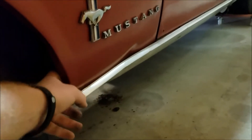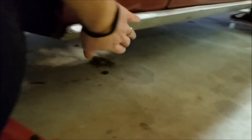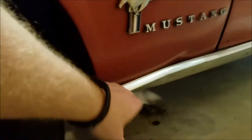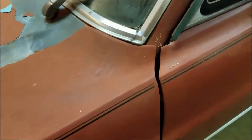I have some fender damage that I didn't have prior to moving across country. In the cross country move the trailer lost an axle, and in the aftermath when we pulled the car out of the trailer we found that the axle itself had popped up through the floor of the trailer, nailed it, and ripped out some of the trim. The trim was in good shape before all this happened. It also creased the fender — that should be able to be pulled out if this fender is rust free, so I've got to check all that. The fit and finish on the fender is in decent shape, headlight buckets aren't too bad, and all my other gaps were good. I just need to see if I can bend out the damage down there and hopefully it didn't get to the rocker.